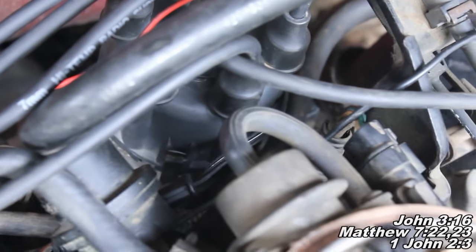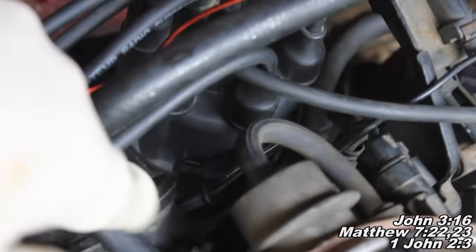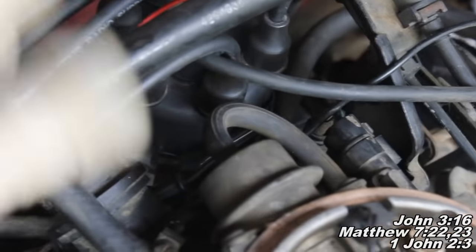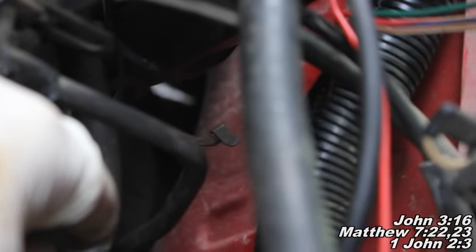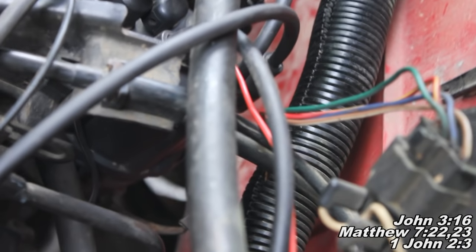And basically we've got to remove this guy. You can see right there where my fingers are — there's a little clip. It's basically one of those little locking clips where you pop them off and then put them back on and it tightens up. There's one there and one on the opposite side as well. Here's our other clip right back in there. Just take your finger and pop him off right there — you can see it's just hanging off there. Remove both those clips and then we'll be able to remove your distributor cap.